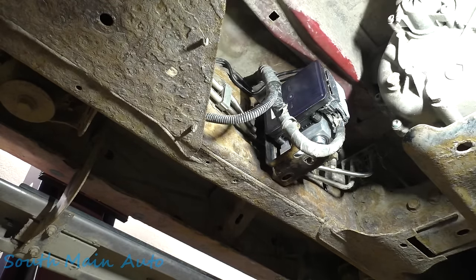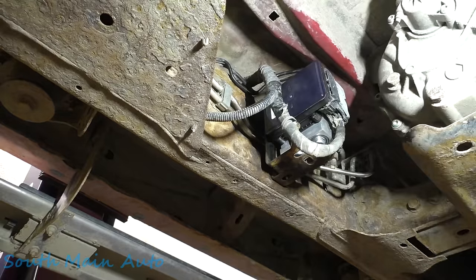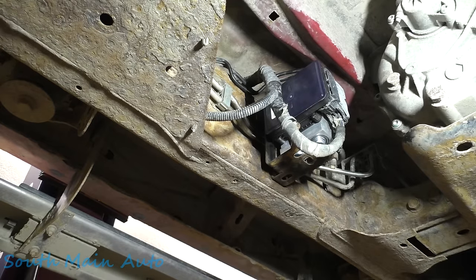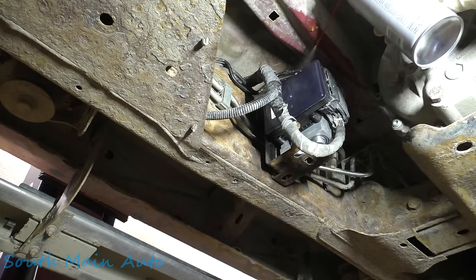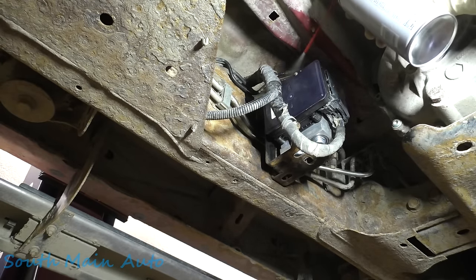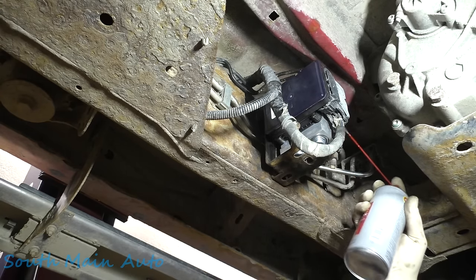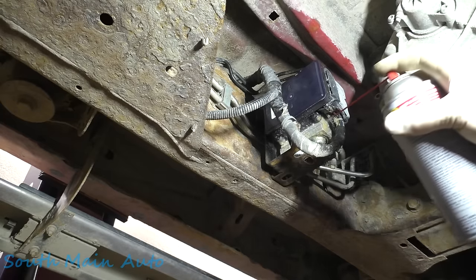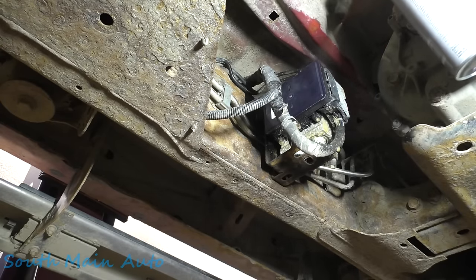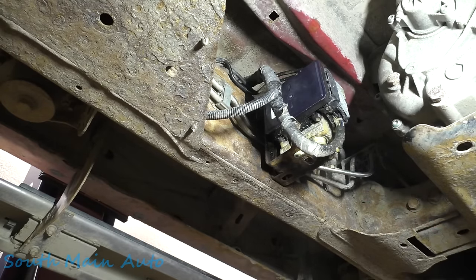As I mentioned, we're gonna take and blast that down with some fluid film because we did have to take some of that plastic coating off the lines to get the nuts to spin. Oops. We'll give it a full douching. Make sure we get everything. Blast these front ones. We'll hit the motor. That way in a couple years when this baby's down at the wrecking yard, you pull it a bath. Boy, somebody will hit the jackpot with this one. Perfect.